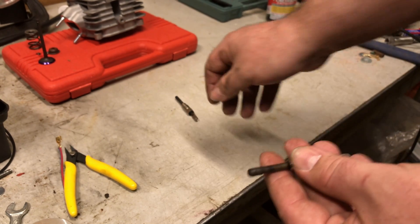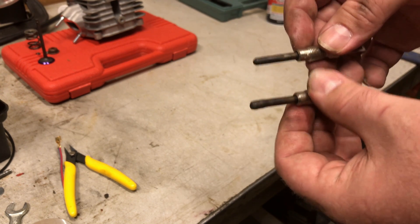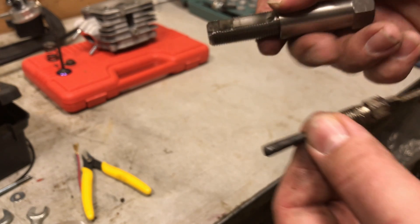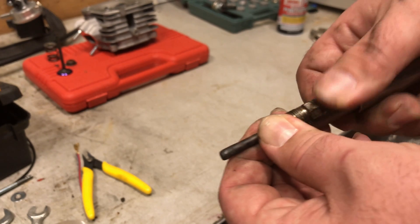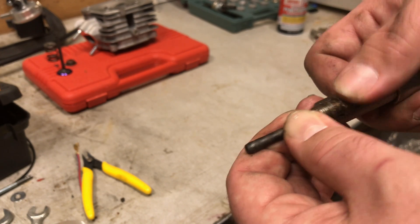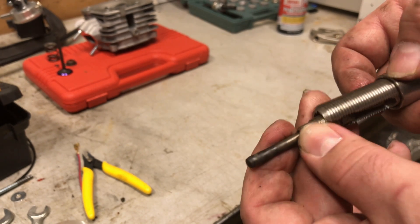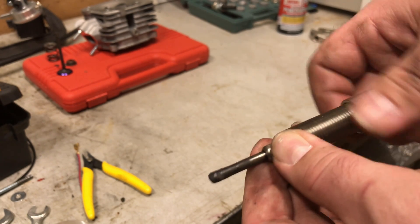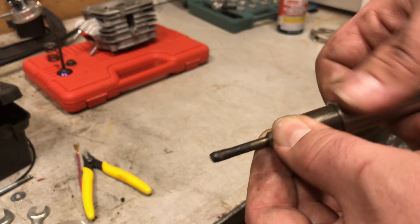This one — I don't know if that's a factory installed unit or not — but the tip is so swollen on that thing it would never come out of that cylinder head easily. When they get like this, you have to have a puller to get that glow plug out of the cylinder, and you don't want to twist that off in the head, because that could mean bad things. You might have to remove your cylinder head if one of these twists off in there or pops off inside the cylinder, because there's no other way of getting it out.